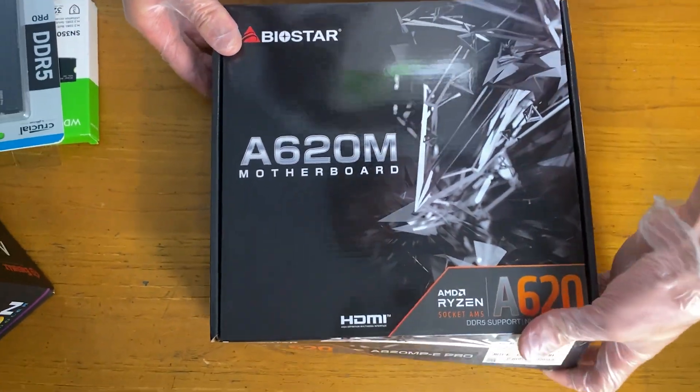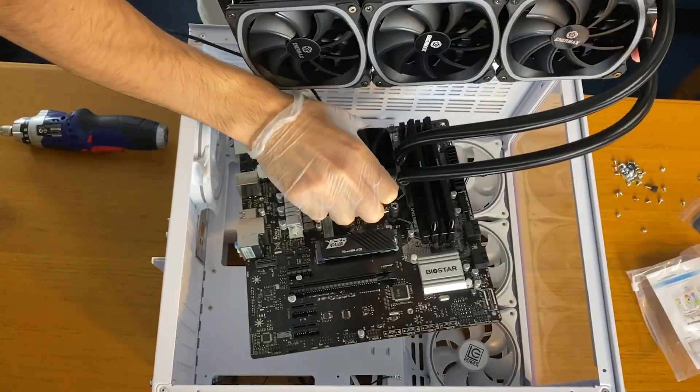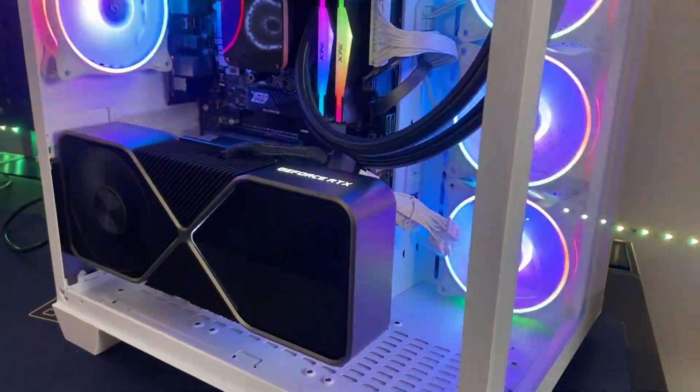My final recommendation: if you're just gaming — buying a 7800X 3D or a Ryzen 5 7500F, which is the best-value CPU in my opinion — and you want to upgrade your CPU in the future, buy a B650. I don't really recommend an A620, even though I've done a build with a Biostar A620 in an LC-Power case and it ran flawlessly with a Ryzen 7. Still, I don't recommend the A620 because of lack of features and poor IO. Only buy it if you're on a very strict budget or going ITX. Otherwise, buy a good brand B650 — you can even get away with a cheaper B650.